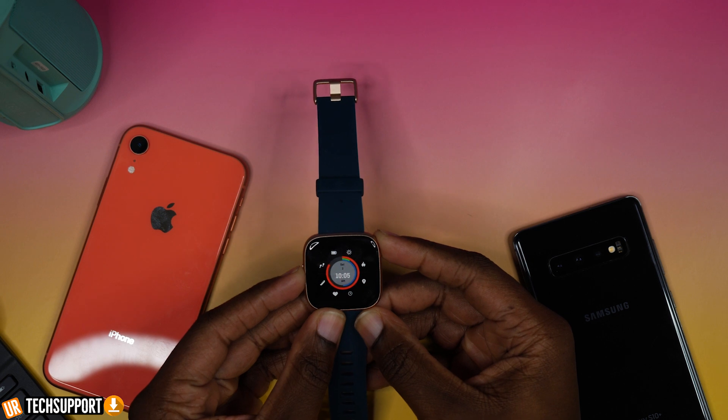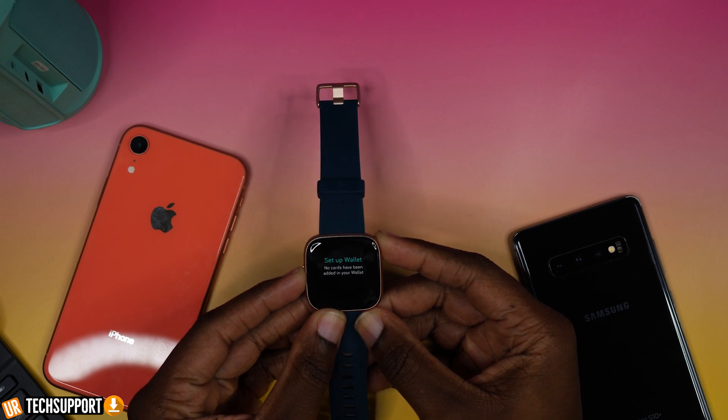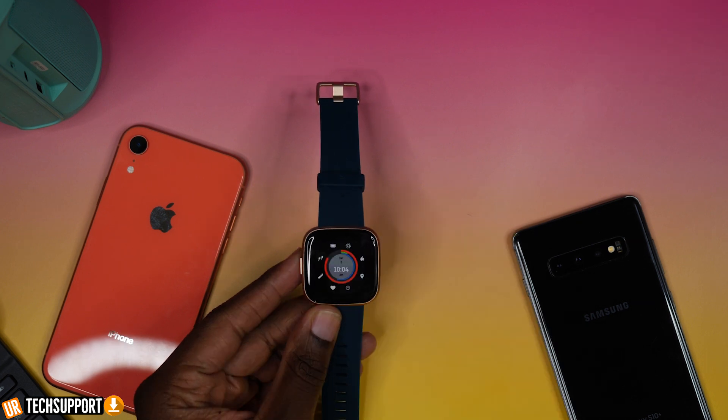If you go into the app and you're trying to add your WiFi connection but you're not seeing it, or you're unable to add the WiFi in the Fitbit app, one thing you can do is reset your watch. Doing a full reboot of the watch itself can help. Hard press the button on the Fitbit watch, wait until it completely powers down, give it a couple of seconds, then press the button again to power back up. Wait for the Fitbit logo to disappear and your time to return on the watch face, then go back into the app and try to add your signal once more.